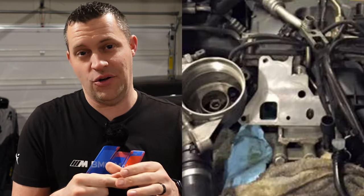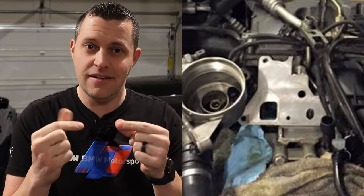First thing right out of the gate is the oil filter housing and oil cooler housing gasket. Not all N54s had an oil cooler — that usually came on the sport package — but you're definitely going to have an oil filter housing. The problem is that gaskets don't last forever. A rubber gasket is going to fail over time, get brittle and pinched, allowing oil to leak down the front of your engine block. BMW designed that oil filter housing with a coolant channel right inside, so if your gaskets are flattened and oil is leaking, it can contaminate your coolant.